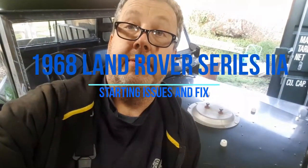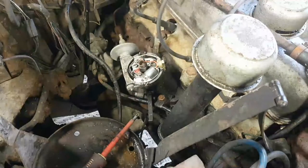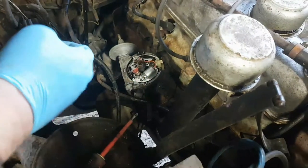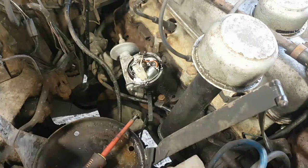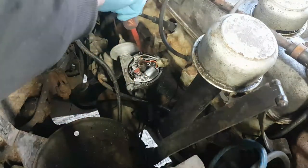We've got to suss out why this isn't working. The battery is a bit shagged but even with the charger on it cranks over way too many times before it thinks about firing. So I'm looking at the ignition circuit first of all. Quarter inch. I don't even have to take that off because I can come off with the base plate. If I undo this screw here we've just got an earth cable to it.